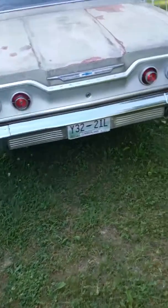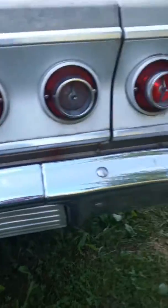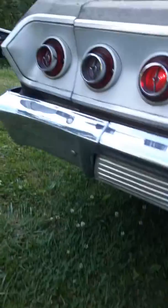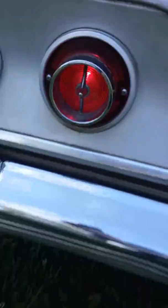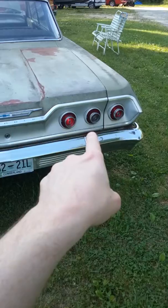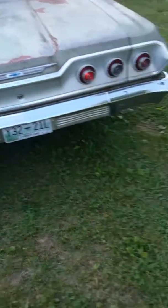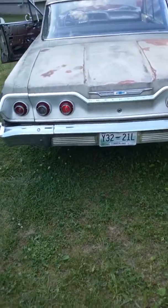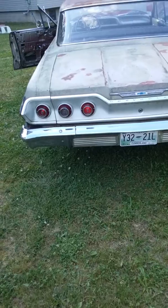I need your help. I know it's got to be a grounding issue. As you can see, I've got the headlights on and the taillights are on — even that one works, though it's kind of dull. But whenever I hit the brakes, these over here on this side get brighter like they should, and those go out. I'm assuming that's got to be some kind of grounding issue.